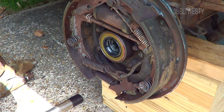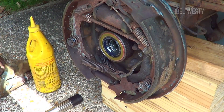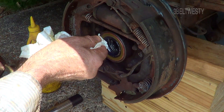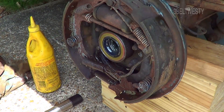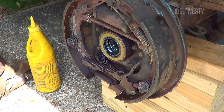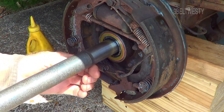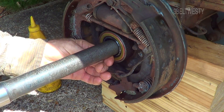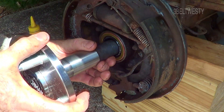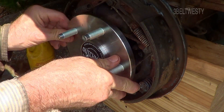Let's put the left side, driver side Dutchman in — a little bit of oil in there, got some grease, kind of get some of this on the outside. Put some brake cleaner on the part that I spilled. I'm going to take the protective piece off, put this in here, try to support it so you're not putting the weight on the seal yet, and then lift this up. There it is.